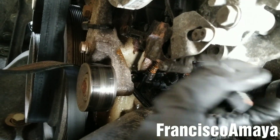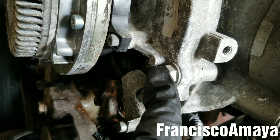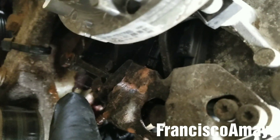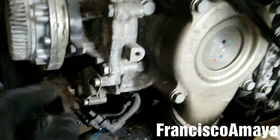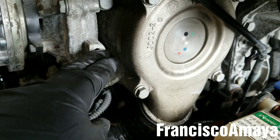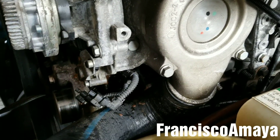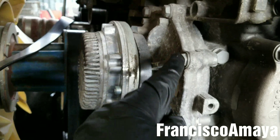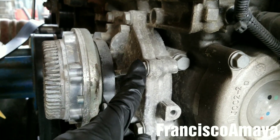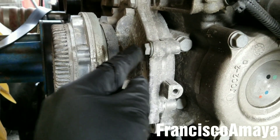With both plugs out, I'm going to be removing the bolts that hold the water pump in place — nine in total. There are some over here and some behind the water pump. First, make sure the water inside the engine block is completely drained, because if you don't, as soon as you open the water pump a big amount of water will come out. The size of these bolts is 13 millimeter — don't use half inch because it's too tight. Use 13 millimeter.